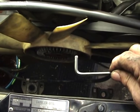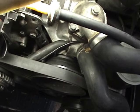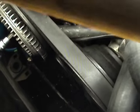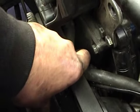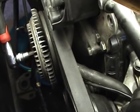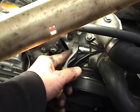It's a 5mm Allen head key you need to undo these bolts. To give myself a little bit more of a chance, I'm going to pull off the pipe here that goes to the heat pump. There's one Allen head screw down there for a bracket and just one nut here. What we've got to do is down in there there's a groove and a slot — we have to cut a 4mm screw and shove it in the hole down there and clamp it through this clutch to stop it spinning, and then we can undo the center bolt. I'll take this pipe out just so I can get a piece of material down in there. That's a 10mm socket, by the way.